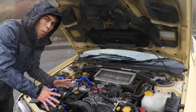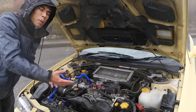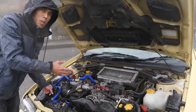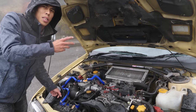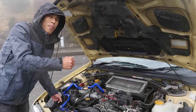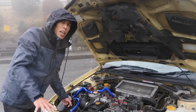So this is an over-square engine compared to the under-square engine, which gives it much more revability. Having that rev range, which can go up to almost 7,900 RPM redline, combined with a high-response turbocharger, gives that punchy push back into your headrest when you push it above 4,000 RPM. And this is a characteristic that makes the STi distinctively different from the Lancer Evolution.